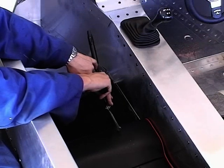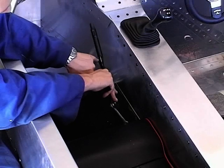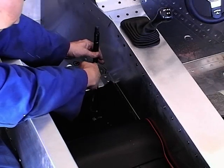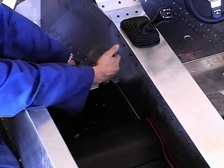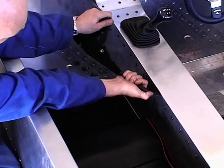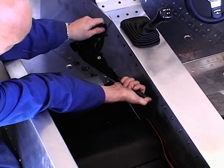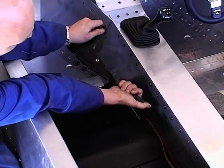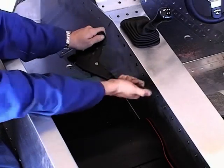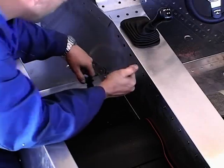When you do that, you may just have to knock a flathead screwdriver in between the wall of the handbrake and the cable, just to make sure that the handbrake still functions as it should. And as you can see, you've got a ratchet type system here, so make sure that it operates and it's going to click back in and work as a working handbrake. So once you've done that,